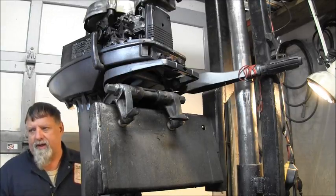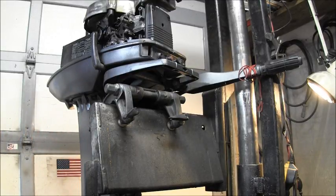Okay, now I don't want to torque these down just yet. I want to put them in there, not finger tight, but as soon as I get a little resistance, I want to stop. And what I'm going to do right now is go get me a cup of Joe. And after that, I'm going to make me a turkey sandwich and eat my lunch. That'll let that set up for about a half an hour on that high heat gasket maker. I always like to do that. Put it in there, let it set 35, 45 minutes. Then come back, torque it all the way down.